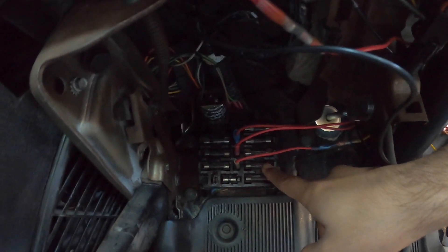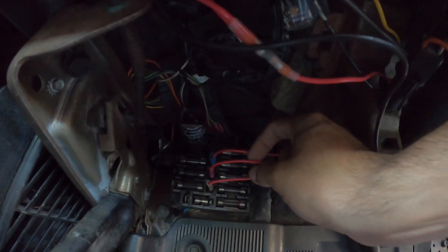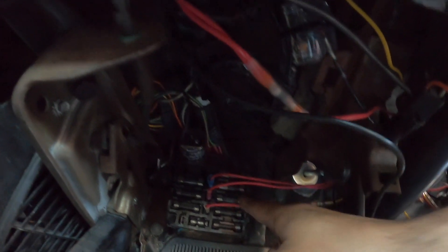For all my accessories, I'll show you: the Chevelle has a factory fuse box with three options — battery, ignition, and accessory. If I had an accessory I'd route it to the accessory slot, and if I had another one I'd use a T-clamp to add another wire, so all the power was coming off that one wire through one fuse.